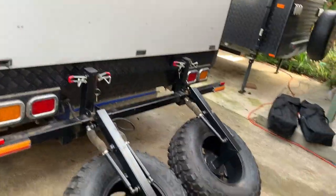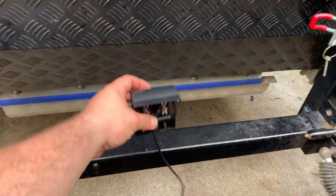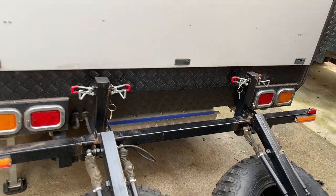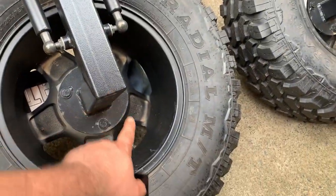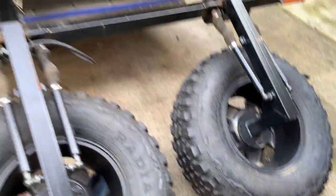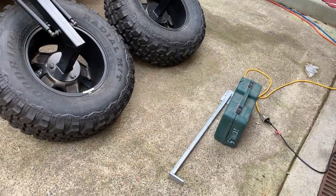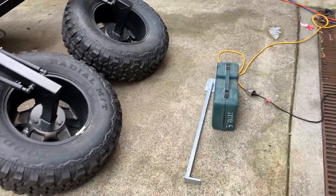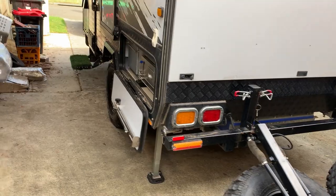What we're working on today is a few more mods for the van, and trying to install a rear view camera. Under the van now, as you can see, I've got the back folded down. I've done a bit of mucking around this morning to see where we want to mount it. I looked at mounting it direct in the middle here but I think it's just going to be a little bit too low — won't be able to see clearly over cars and stuff like that. So we're going to do a bracket off here, come out and run this way to about the middle of the two tires so it's up a bit higher. I've got just some scrap steel from another thing I made. Marked it out, so I'll start the process of cutting that, then we'll do some welding. When it's all ready we'll disconnect all the batteries before we weld so we don't destroy the batteries, then we'll run the cable all the way through to the front.